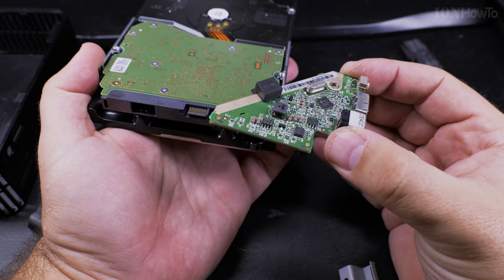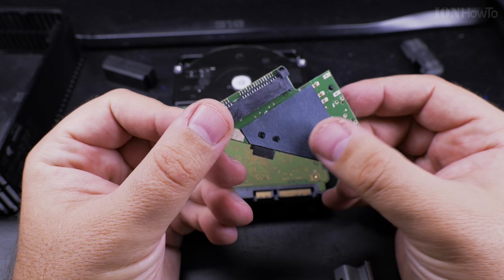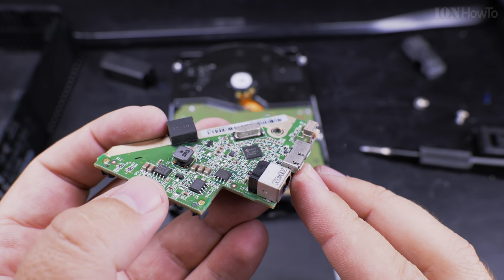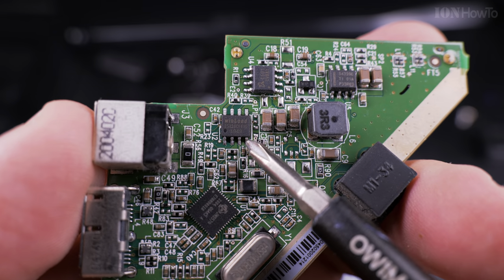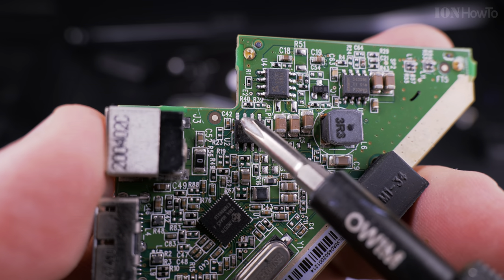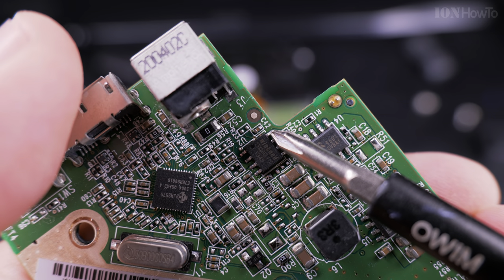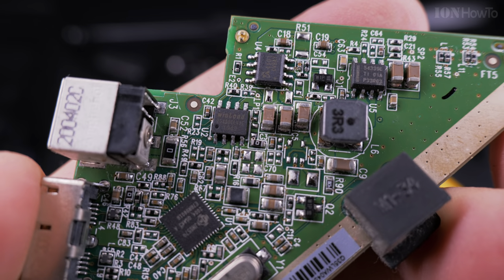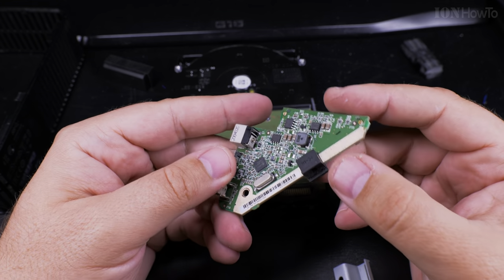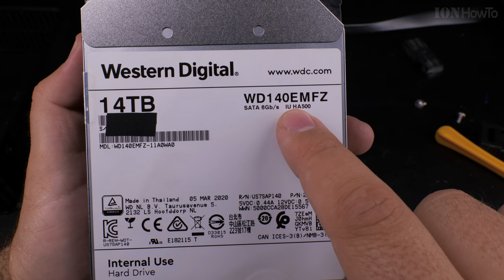The nice thing is that this board connects via SATA, so you could use it for any Western Digital or non-Western Digital drive and you have a USB converter. If you have a drive that is not Western Digital, you have to disable pins seven and eight on the Winbond chip - that's the Winbond chip because it's written Winbond on it. From the dot which marks pin one, you count around to pins seven and eight. I will put a link in the description. If you have a Western Digital drive, there's no need to do that.